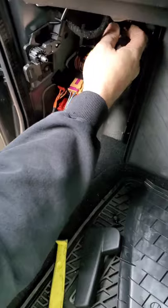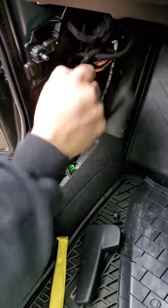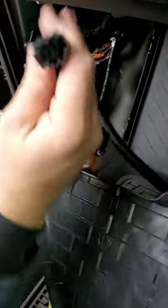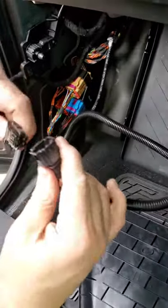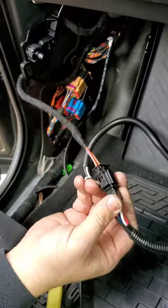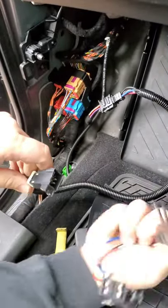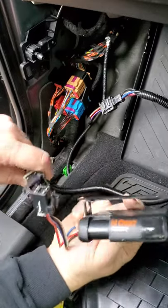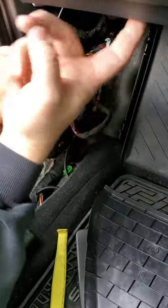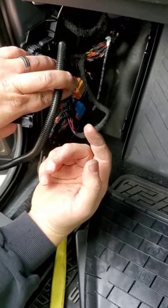With the tow package, they're all pre-wired for electric brakes. The wires are tucked in here — there they are. You buy this adapter harness off of whatever website you want; I use eTrailer. They have a lot of stuff for towing and trailers. It'll plug directly into your electric brake wire harness. I've got a Curt Tri-Flex brake controller, and it'll plug directly into that. What I'm going to do is run the wires up to this sill cover here and take the first two or three screws out of it, then run the wires out of a hole in there.